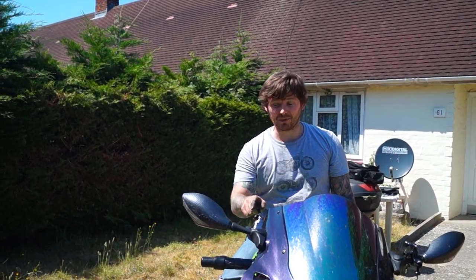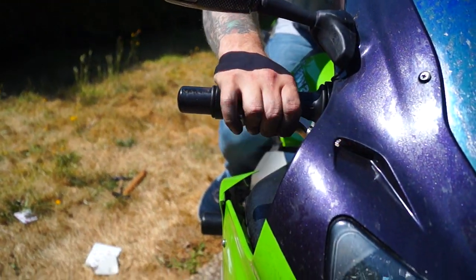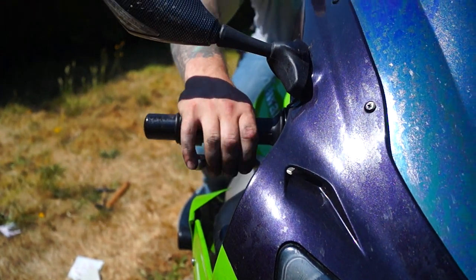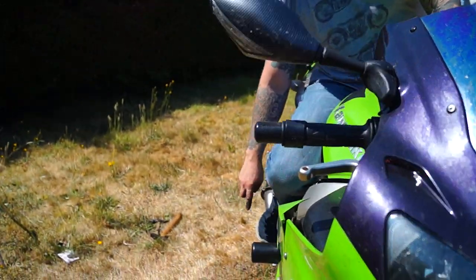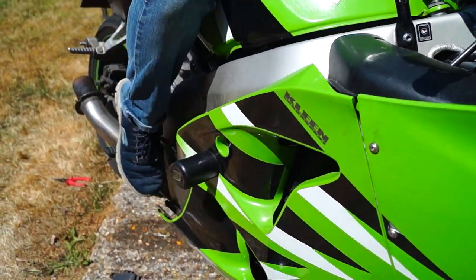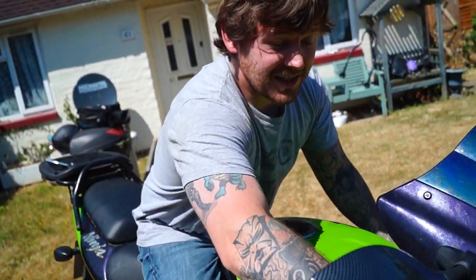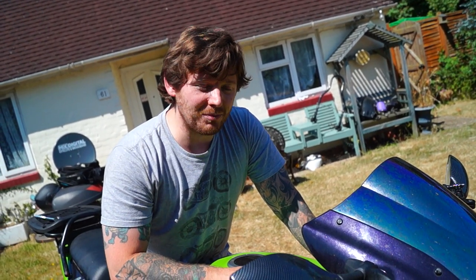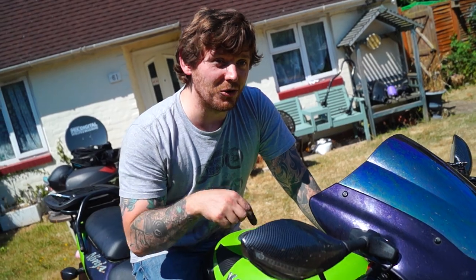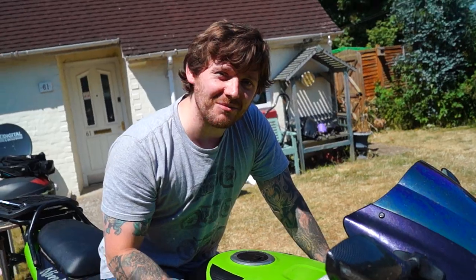Now that we've changed our brake pads, the only important thing left to do is to pump the brakes. As you can see, this goes straight in — that's because we've got to pump the fluid round, and that'll take a few pumps. There we go, now the pressure's come back. We're going to do the same with the foot brake down here, just going to pump it up — and there we go, now it's back up to pressure. Test your brakes, and of course ride carefully for the first few miles because the new brake pads are going to be bedding into your old disc. Stay safe, and I'll see you soon. Thanks for watching.